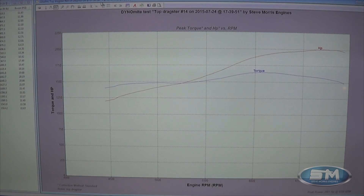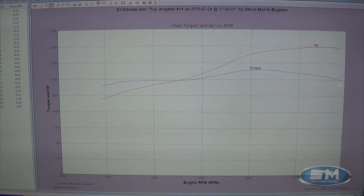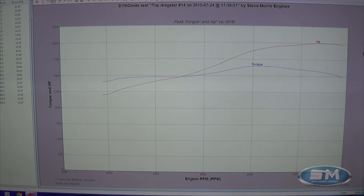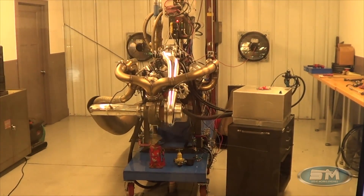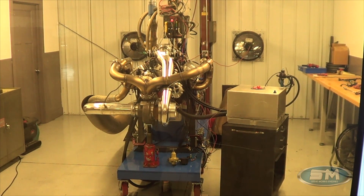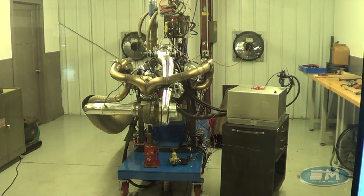We keep these things a little softer in the RPM — we don't need to rev the snot out of them. Although this thing will be happy to go through the traps at 7,500 to 7,800 RPM. It really won't fall off much up through there — it's just flatlining. I don't bother to run it way out to that 8,000 RPM area because it's going to just flatline and lay over just a little bit, nothing you'd ever really feel in the dragster. The engine can be used for anything, but we have it packaged to actually fit in a dragster — most unmodified dragsters too. Anything with about 16 to 17 inches between the face of the block and your firewall.